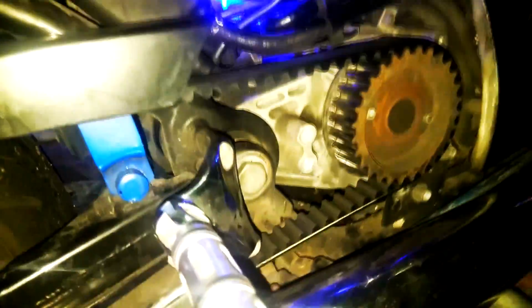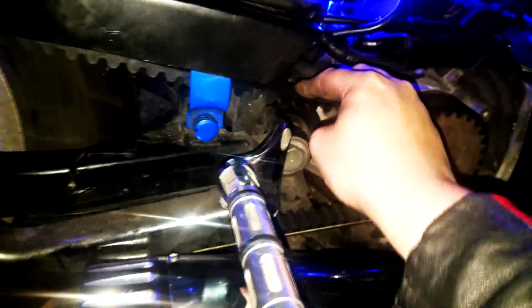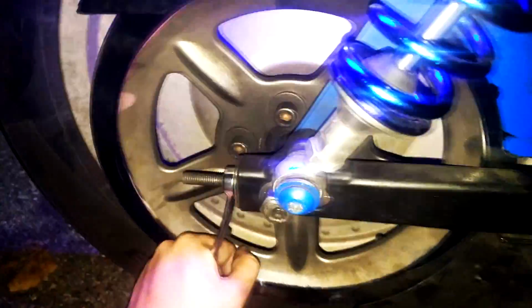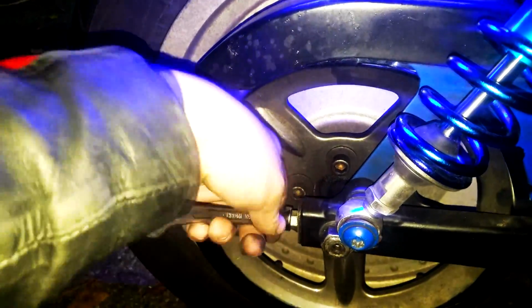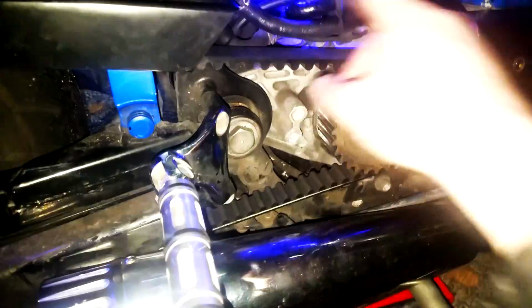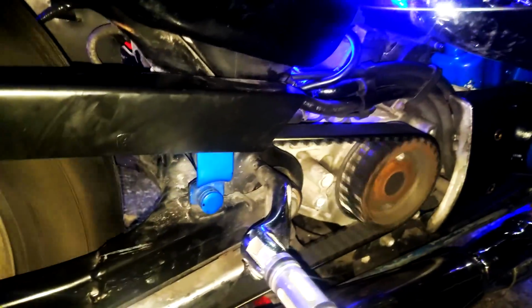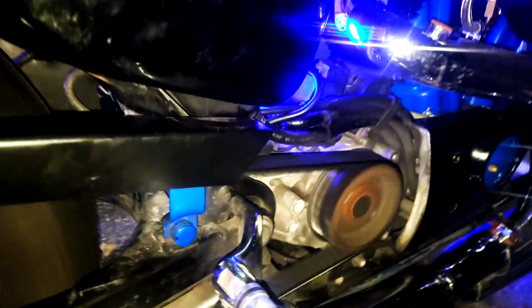And the last thing I want to do is over tighten it again. So I'm just playing with it, pressing as hard as I can, just to see how much deflection is going on. It seems to be a lot of deflection, so I'm going to keep cranking on this one side until I hit the sweet spot that I think is right. See, now it's deflecting much, much less, and the wheel spins freely, and I don't see any jumping of any sort.